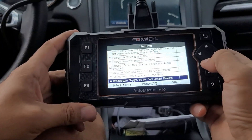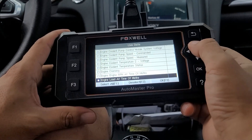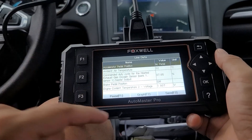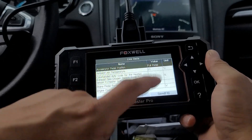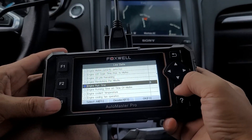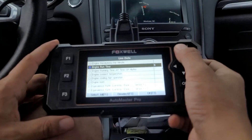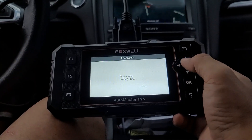This is just one small part of this unit. If you have any engine code, look at engine cranking. Engine coolant temperature voltage — 1.7 volts. If I start the engine or hit the gas, you can read that. Engine run time — when you're buying or selling cars, you can see the actual engine run time right now and total run time. A lot of cop cars have huge engine run times, or people who idle in certain areas will show a very high engine run time.